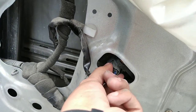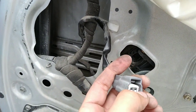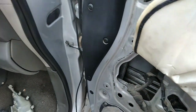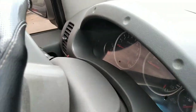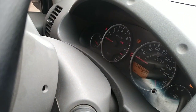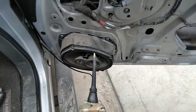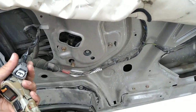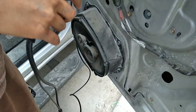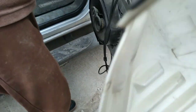So let's check — I'm gonna go ahead and unplug the connector for the motor. You just have to squeeze it. This is where we're gonna check if we're getting power and ground when you hit the switch. We're gonna make sure we have the ignition on. Alright, we have ignition fully on. If you want to know the process of how to remove the door panel, I'm gonna leave a link in the description — it's just a short video on how to remove this door panel.